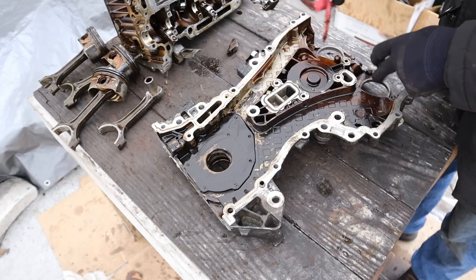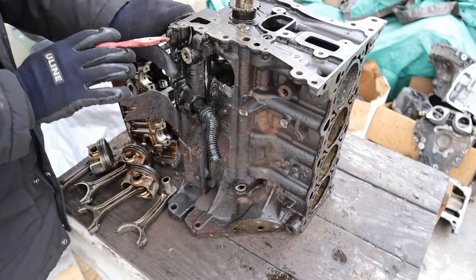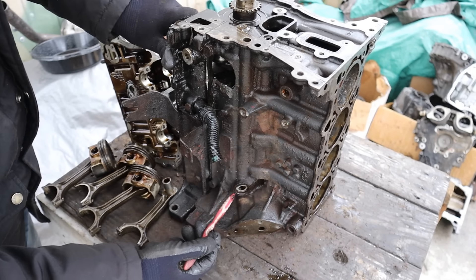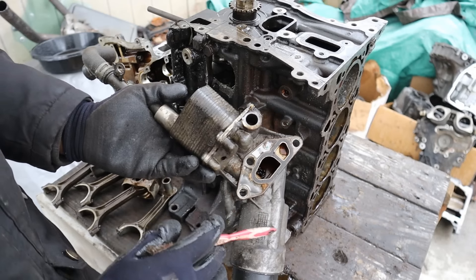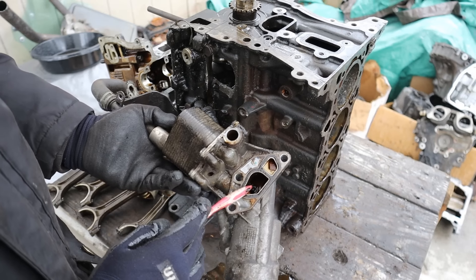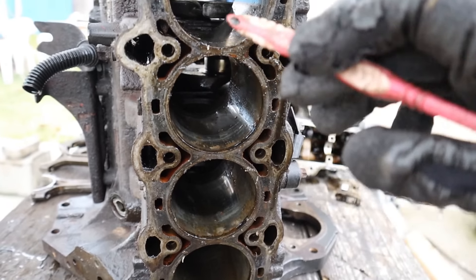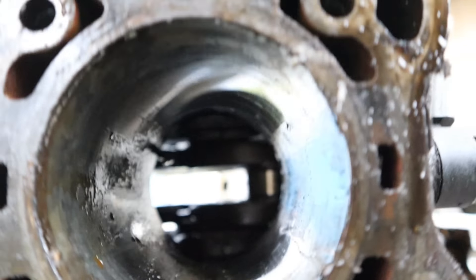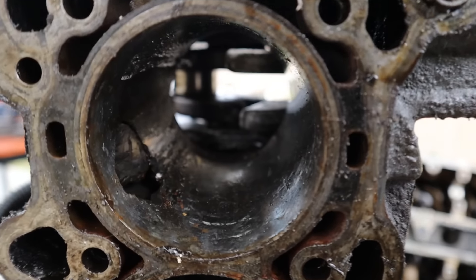We've got the chain running around here and coolant passages that pass through the block and the head over here. Oil flow is going to enter the engine block over here and be sent down this oil gallery all the way to the other side of the block, where we have the oil cooler and oil filter assembly. The oil filter and cooler assembly is going to take that oil, cool it off first, then send it to the oil filter so it gets nice and filtered out. The clean oil is then going to be sent straight into the block through this port over here. Oil from there is sent to a gallery that runs along the length of the block. And if you look closely you can see there's actually a little pipe thing — that's the oil sprayer that's going to line the cylinder walls with oil to hopefully lubricate that piston. Except for this one.